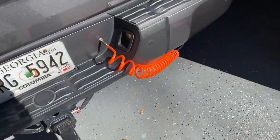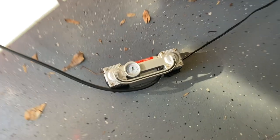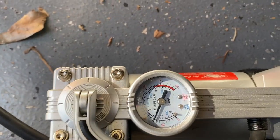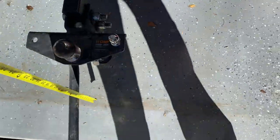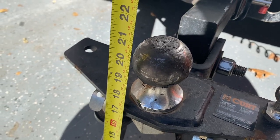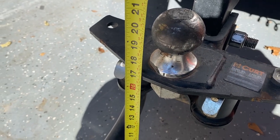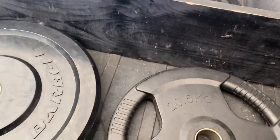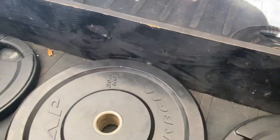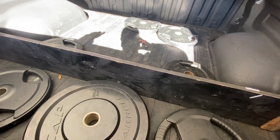I've added some increased air and I'm right at about 38 psi. At 38 psi I'm right at about 21 and an eighth inches — that should be just about perfect when I'm loaded. So that's the new target. We'll go ahead and unload all this weight from the back end and see how high that raises us, then drop the airbags back down to right around 21 to 21 and a quarter inches again.